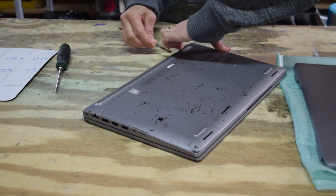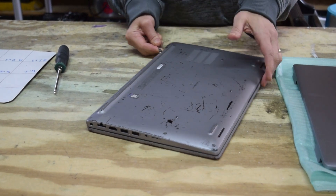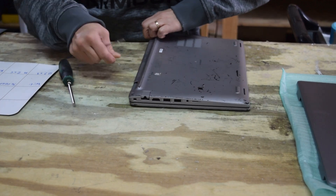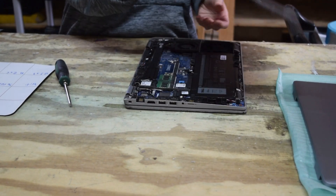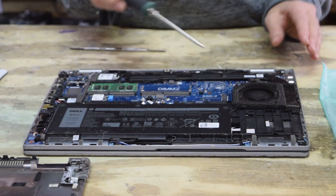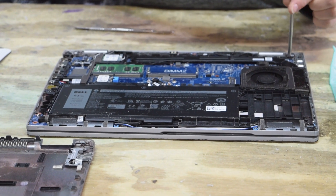It's very easy to break one of these plastic tabs, so try to get the tool into the corner and just gently start it going, then work your way around the edge prying up very carefully. Finally you'll get to a point where it'll pop right off. It's held on by little plastic tabs — you don't want to break those tabs so that you can reassemble this properly.